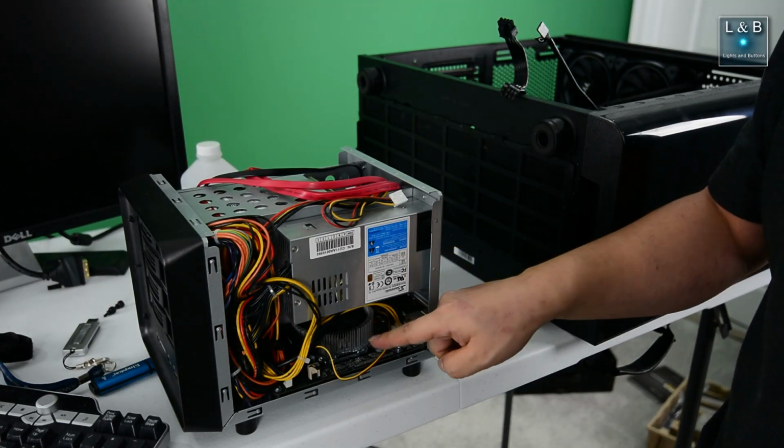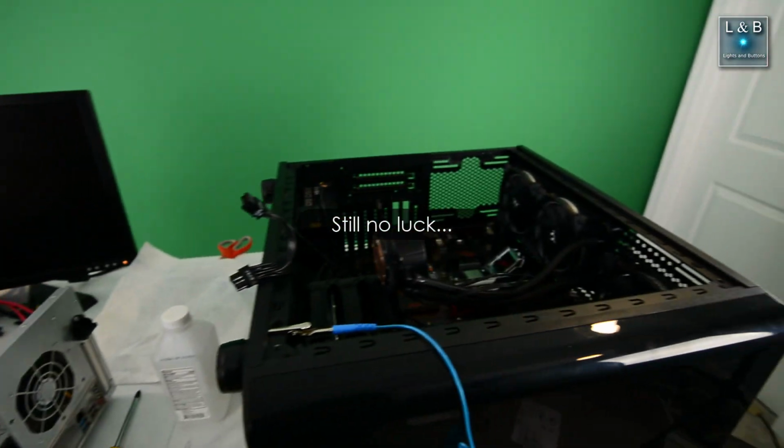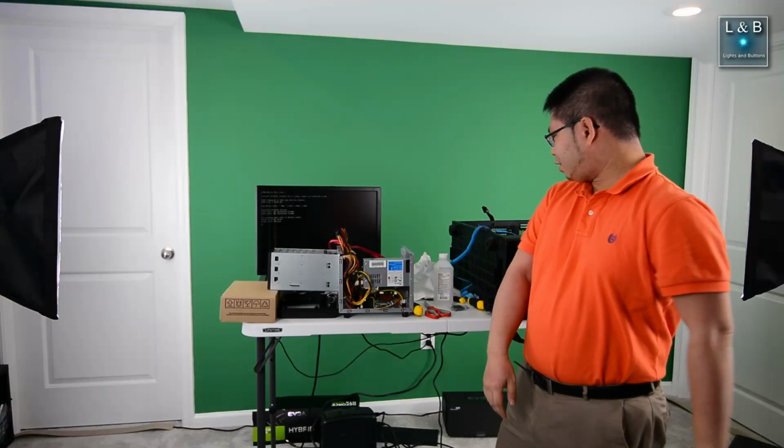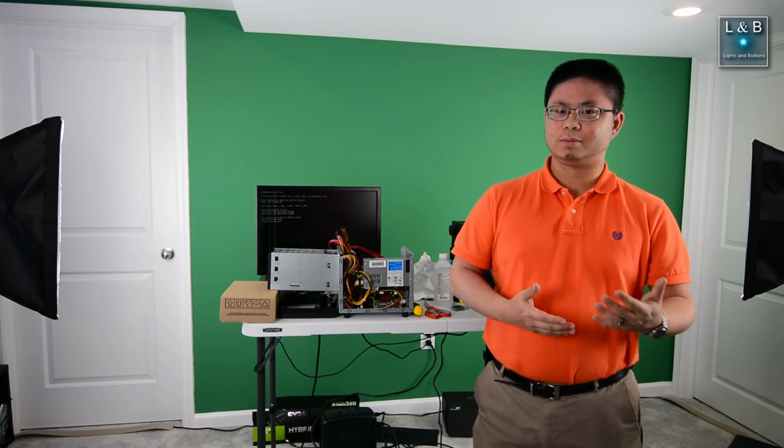Okay, so this has become a multi-day operation. So I took out the old CPU, or the 9th gen CPU, and plugged in the new one, a 6th gen processor, fired it up, and 1 second later the PC turned off. So no luck there. And I thought, well, the motherboard was designed for the 8th gen processor, so maybe the 6th gen was a little bit too old even though it shared the same socket.